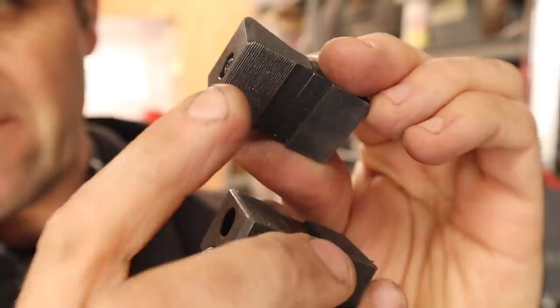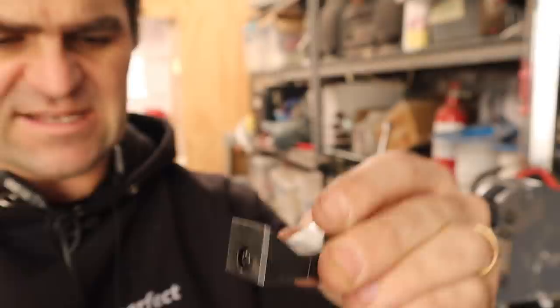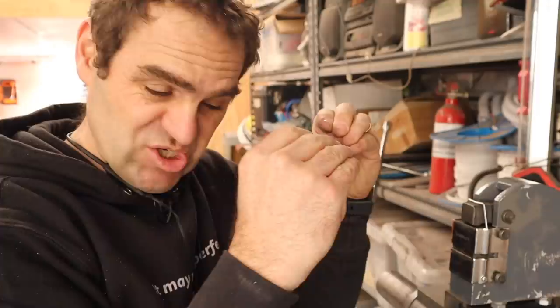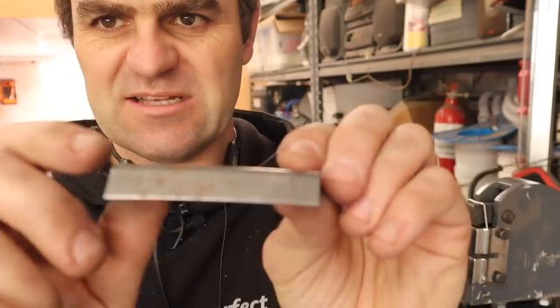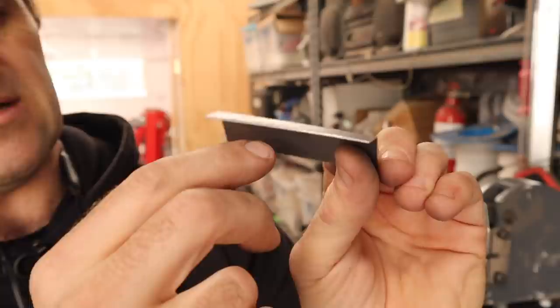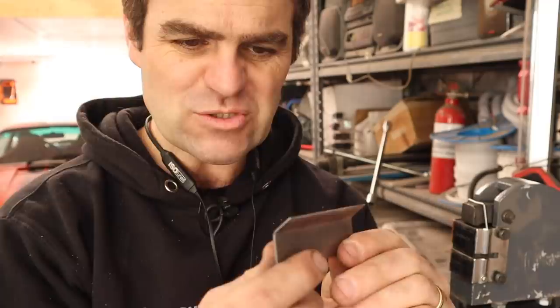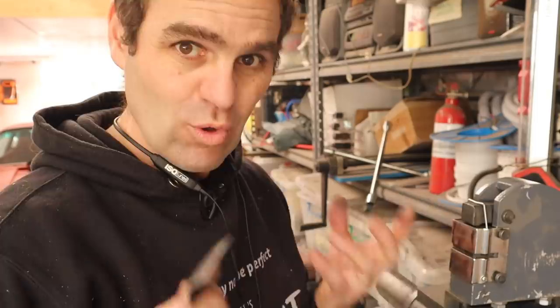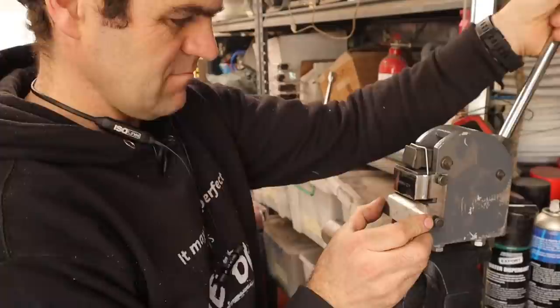The shrinker has fine little jaws inside — they're two pieces held together. As it clamps down, one set grabs the metal and pulls it apart for stretching, and the other grabs it and squishes it together for shrinking. By squishing this edge together, you can see it's put a little curve in it — not huge, because I don't want a very large curve, but that's almost what I need. Adding that little bit of curve rather than a straight bend gives us more of the natural shape the car had there, and the patch will look much better.